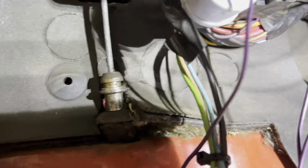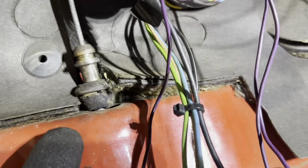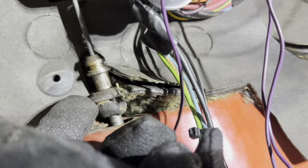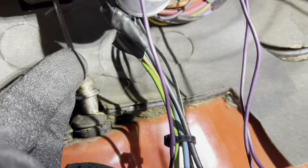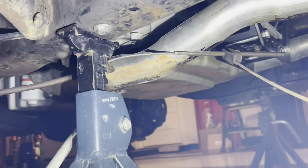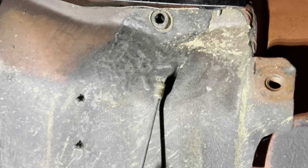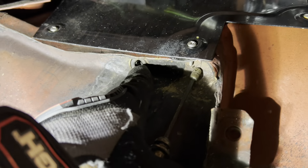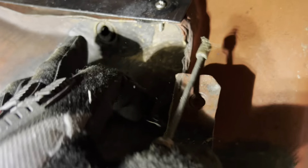I'm back to trying to remove the parking brake. My technique is going to be to pull this grommet out from the top and over this ring, and then this will slide right down. There's also another bracket somewhere on the bottom that I removed. I was able to pull the parking brake cable out through the bottom of the driver's side firewall — the grommet's a little loose.